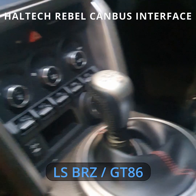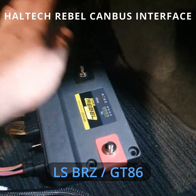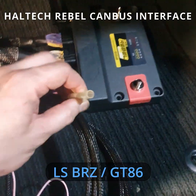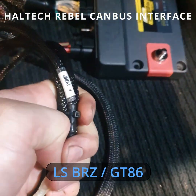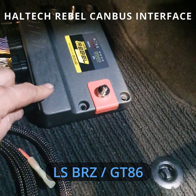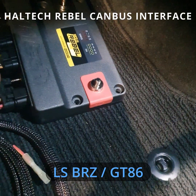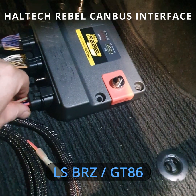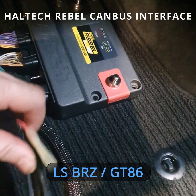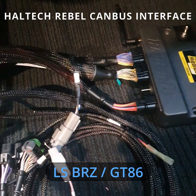That's pretty much it for connecting up the main requirements. The other thing you'll have to do is connect the positive and negative of the Haltech to your battery. There is actually a wire here as well labeled 'fuel pump' - this is a direct output out of the Haltech power connector. This new Haltech Rebel is also a power distribution module, so it can actually power a few big loads directly - things like the fuel pump, the fans, even the starter motor. You can wire this fuel pump wire directly to your fuel pump at the back.